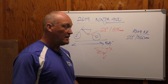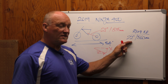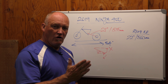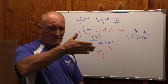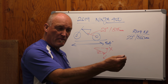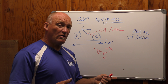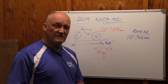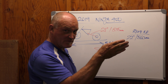Going out to a 1000cc bike, it's not unusual to see 22 and a half, maybe even 23 inches — 580, 585mm — with the wheel all the way back. What that does is help with wheelie. So we were changing the chain angle and chain pull for squat and anti-squat to make the 1000 sit. Generally, a lot of riders will take a 1000cc and pull the rear wheel into the final third to help fight wheeling — very common behavioral trait based on data seen. If you look at a lot of the race series, you'll find that even though those swing arms are custom made, the rear wheel isn't all the way forward — it's mostly all the way back.